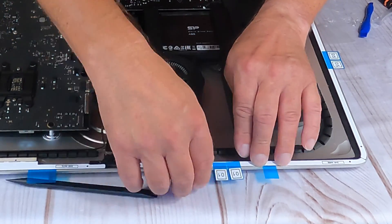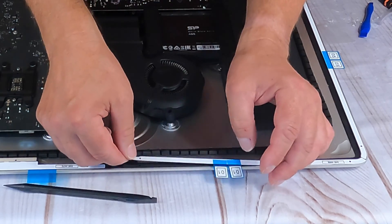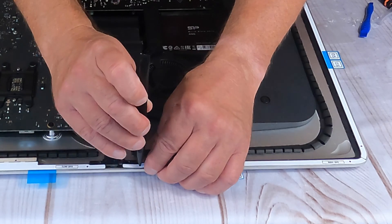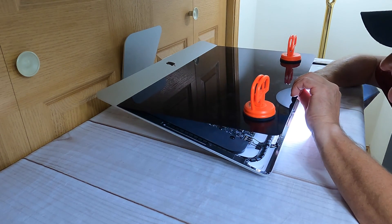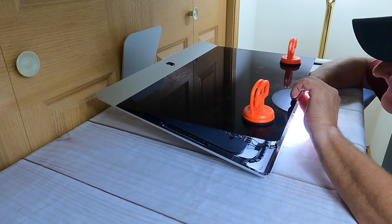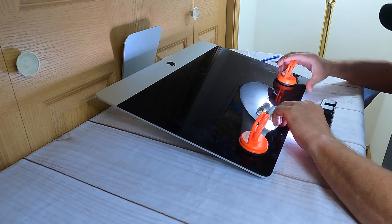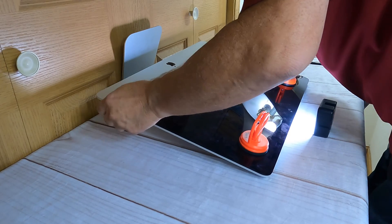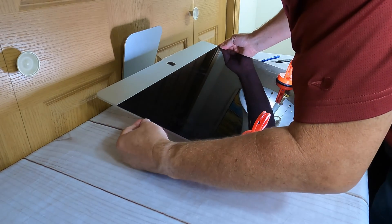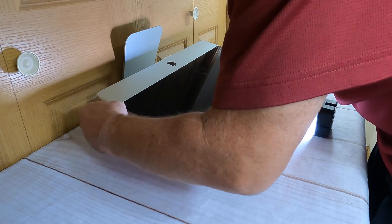When applying the adhesive tape, take your time. Work your way all the way around the iMac applying the underneath. Then when you're ready, return and remove the white portion — the top of the double-sided adhesive tape. When attaching the display, make sure these two corners are lined up, and don't forget to connect those two cables. When you're ready, carefully and slowly lower that display. I'll just pat down the edges to make sure the adhesive has good contact. I might place the iMac glass side down on a smooth, flat, soft surface for several hours — maybe even six hours — to help that adhesion further.